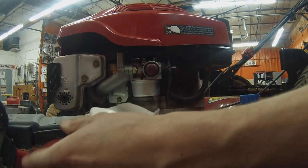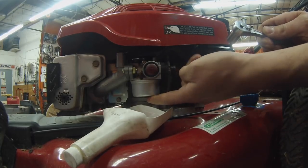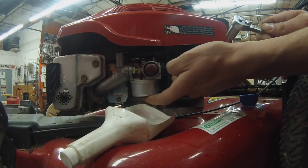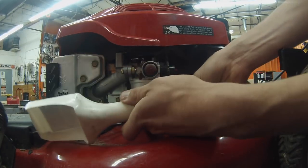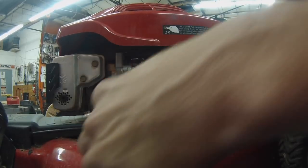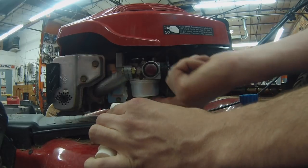To get a fuel sample, I'll put my gasoline catch underneath the carburetor. This is a Tecumseh engine — it has a half-inch bowl nut. A Briggs also has a half-inch, and Hondas have about a 10-millimeter, so find a socket or open-end wrench that fits. Go ahead and crack this loose — gas is starting to come out.